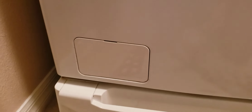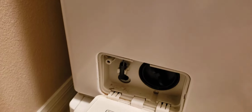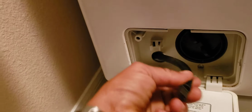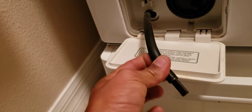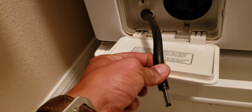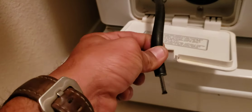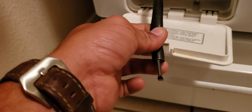You come down here on the front of the machine. There's a filter in here. Remove these. Pull these out, right? Put it in a hose. Remove this top over here. Put it in a hose, in a bucket or something. It's going to be a lot of water coming out, so be prepared to just stop and then put it back, empty it, and then come back again.